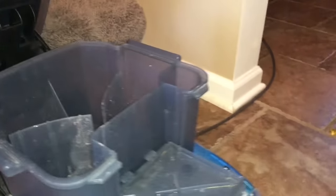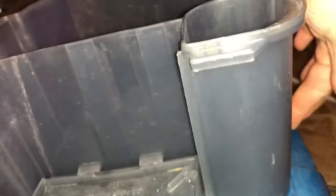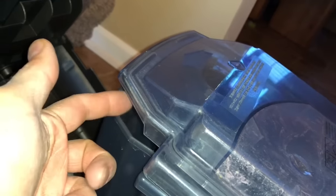Got that down. Now you have to lock your dirty water tank in — this button ejects your dirty water tank. Two things on both sides — lift that up and lock it in place. Just showing people who don't know how to do it. This must be locked in on center. If it's not, it will not have suction because it's not closed correctly. So make sure you have this locked in place and make sure it's all flush right here — that means it's locked.